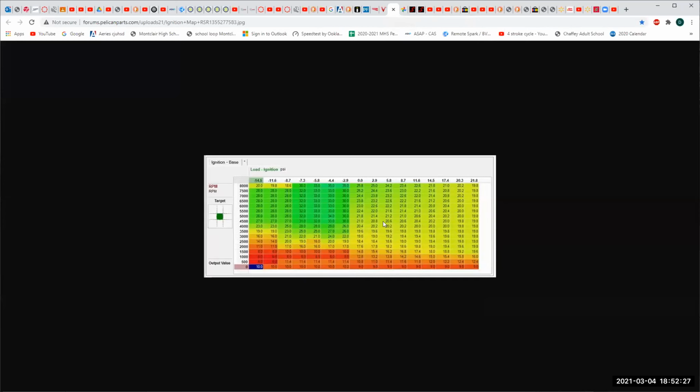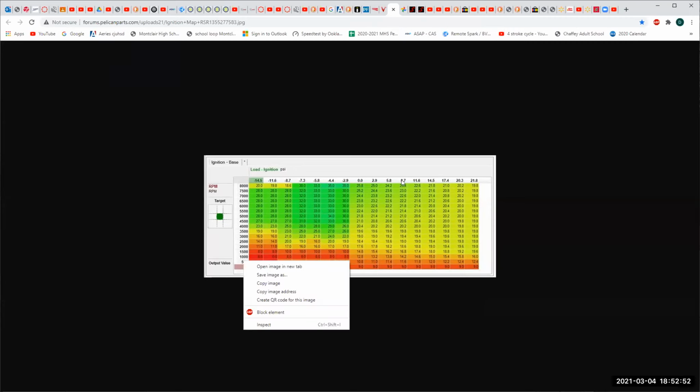Okay, so here's what you do in Professor Brown's class over at Citrus, the high performance automotive. You got to get this dot in that target. So what you do is vary engine speeds and throttle pressure, and it populates this chart. And that's how a real tuner goes for every combination of engine speed, and this is another turbo car because it's got negative and positive values, for every combination of engine speed and engine load. That's the right way to do it.